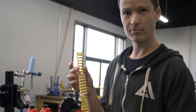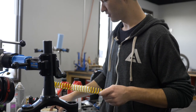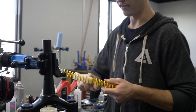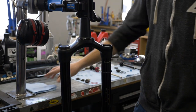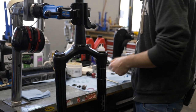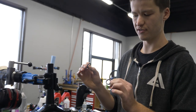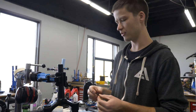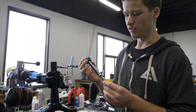So we're gonna put the yellow spring in here. First thing we do, we'll just put a little bit of grease on the spring — that helps quiet it down a little bit. It has a little bit of shrink wrap on here to just mitigate any rattling sounds that you may have with a coil sprung fork, but they are pretty quiet. So we'll drop that in. Then you put in a plastic piece and it has a couple little preload spacers here — this is just to adjust the preload on the spring. I'm just gonna put one in, and after that we're gonna put in the air bump stop.